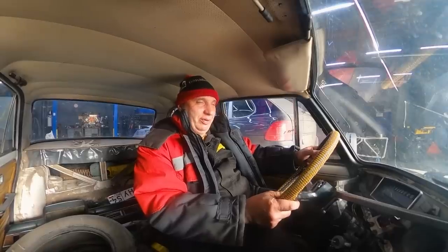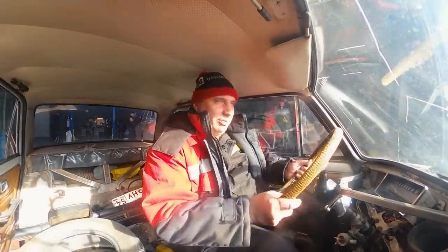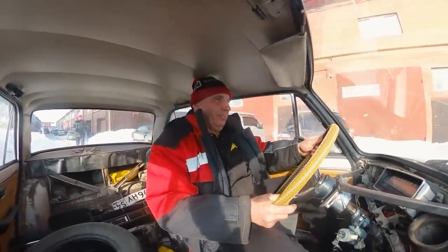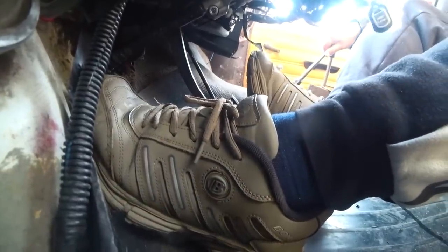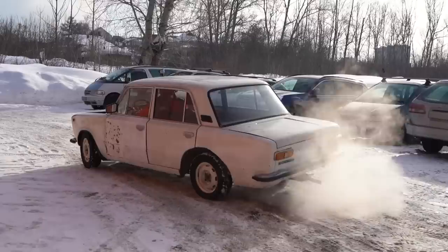Actually, it's not all that fine. There is a bit of... perhaps while the components are not broken in, while the flywheel is still a bit coarse... The car does drive when I release the clutch — drives with no issues. But there is a delay when you change gears, the reason being the inertia. The added weight is a factor. Now we can throw it into reverse — and it's in. That's a good thing. The disc wasn't spinning apparently. Tremendous.